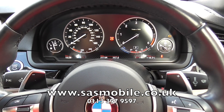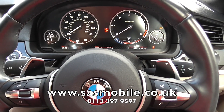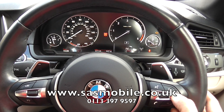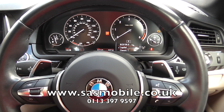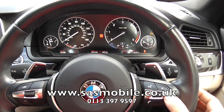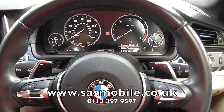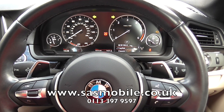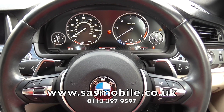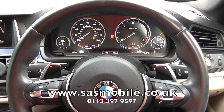This is what you do when you want to change your pin number. However, because we're not changing the pin and we just want to clear the Ghost memory, we're going to enter the exact same pin number again — so 1, 2, 3, 4. You get a flash of the indicators each time you press it, followed by 3 flashes to confirm the first entry of the pin number. Now the second time, we're going to enter it again — 1, 2, 3, 4 — and we're going to get a series of rapid flashes, 4 quick flashes like so. Those rapid flashes at the end tell us it's cleared the Ghost memory. It's learnt the exact same pin number again and cleared the Ghost's memory. So that's all you need to do — the memory's now clear.